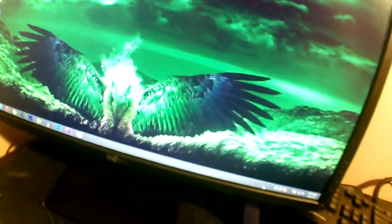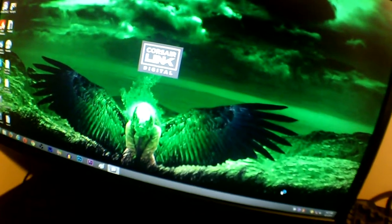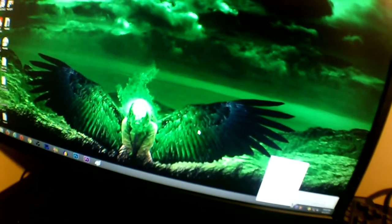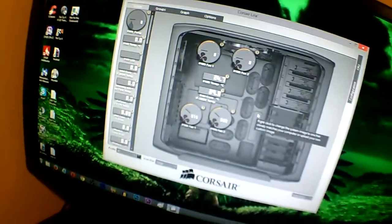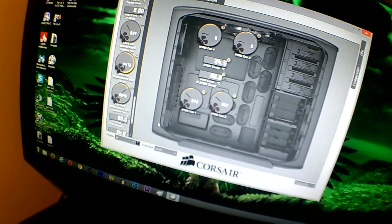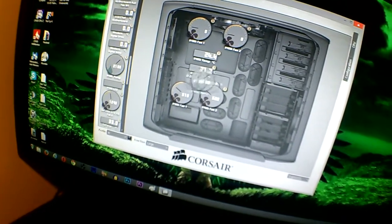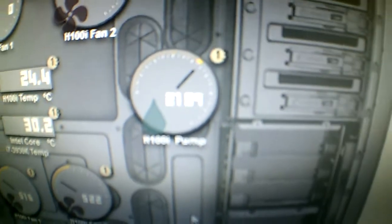They all run at a static value, so that was it. It's still working — I'm recording this probably a week after I did it and everything's fine. It's been crunching videos at full load. The gauge of the wires were the same on the SATA power and the Molex adapter, and I don't think they pull more than a couple of amps, so it's not that big a deal anyway. That's all you need to know to fix it.